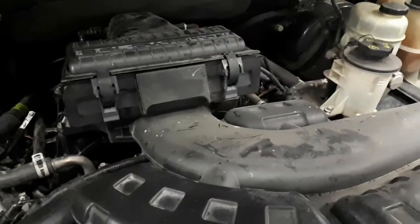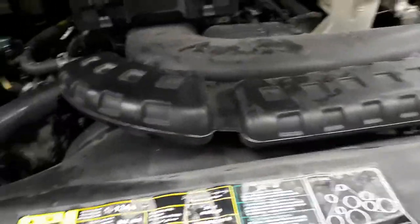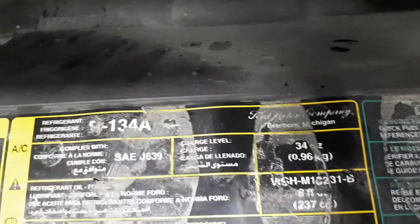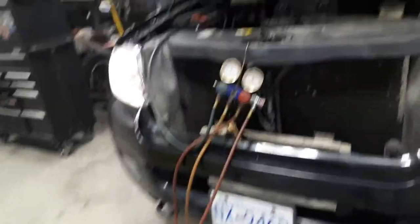I'm not going to measure the air temperature or anything because it's putting out well. I'm an experienced technician. I put the prescribed amount of refrigerant, which is 34 ounces - two pounds, two ounces. Used the refrigerant scale, weighed that in out of our 134A bottle. Everything seems smooth.